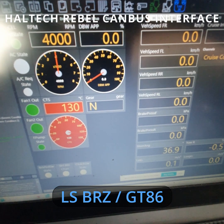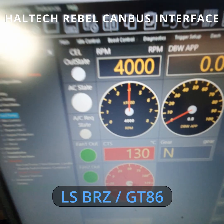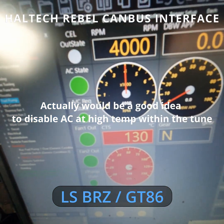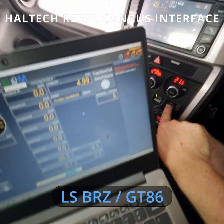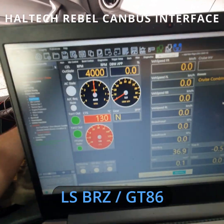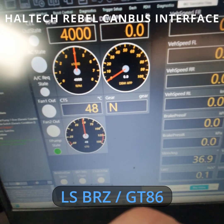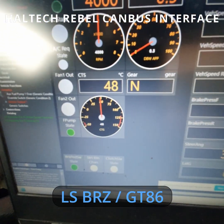All this is done through the translator. We've also got other data coming through - so we have AC. If I turn the AC on here, you can see the AC request has come on. Because it thinks the engine's running, it's commanded the AC compressor to come on. If I turn that off, you can see both of those are turned off. Since it thinks the engine's running, the fuel pump is on - you probably can't hear it but it is running. We've also got the brake pedal wired through.